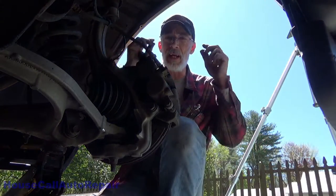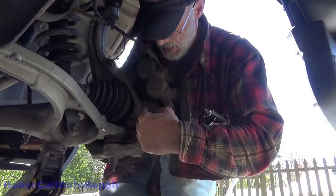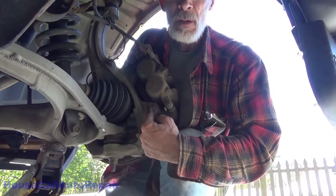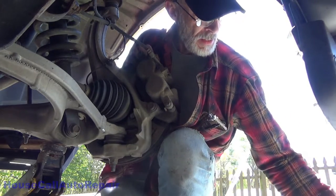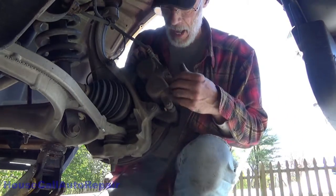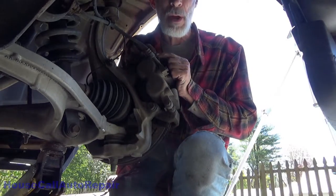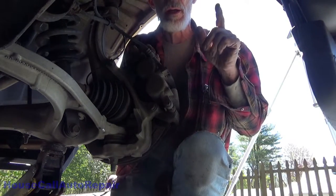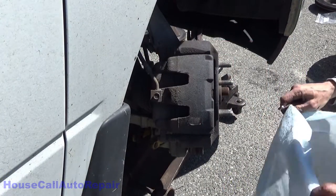Now I realize the lighting isn't ideal for this. I'm actually casting a shadow from the light behind me. We've got 20 millimeter bracket bolts and 13 millimeter caliper bolts. We're going to loosen these up, crack the brake bleeder loose, and then start breaking this down. Let's get this pet trainer underneath here